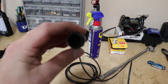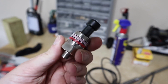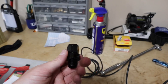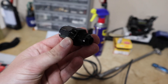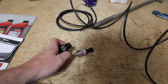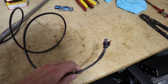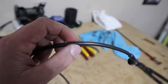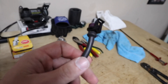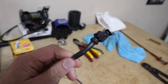These three-wire sensors are pretty simple: you've got a sensor ground wire, a signal wire, and a 5-volt wire. I have an AN line that runs under the intake, so my plan is to use this sensor port dash-8 fitting and put it in that AN line with the sensor. I've already made my cable — it's the Holley three-wire shielded cable with the end pinned on and adhesive heat shrink to seal it up, so it'll be nice and watertight sitting under the intake.